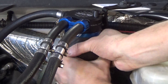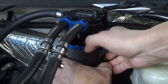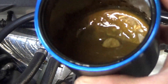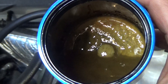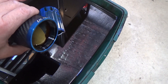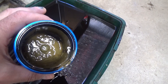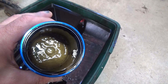Wow, I'm actually surprised — let's go take a look at this under some light. Just under 600 miles, and you can tell that's not straight oil because it's not black. I'm actually quite surprised at the amount of contaminants we caught here. You can see it's not straight-up oil and it has a fuel smell to it.